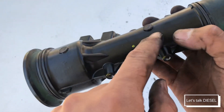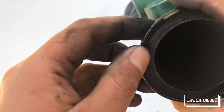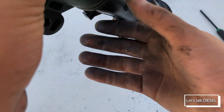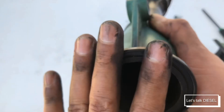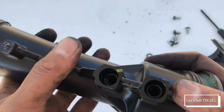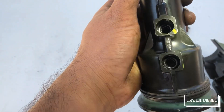If you see any leak from that side, you need to replace the whole thing if there's a crack in here. If this part is damaged from here, of course you need to replace it — same from the inlet side. When you install it back on the truck, make sure the o-ring sits properly, because if you don't install it properly it's gonna leak.